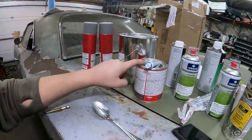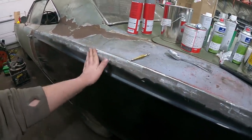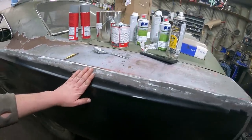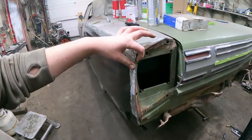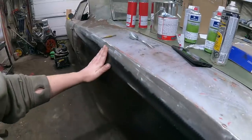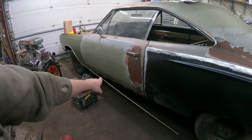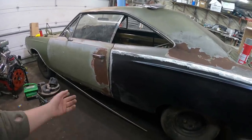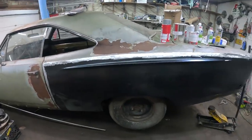I got some fiberglass. The plan is I'm gonna fiberglass just a little bit first, get that down to kind of protect the weld. We'll go down and around and then obviously come over with some body filler. Before we do that, this side needs this little section fixed. There's one little hole on this side I gotta deal with and a little bit of bodywork on the other side on the sill — just a little patch there, nothing too serious, right where the drain hole was, must have had some junk in it and corroded.